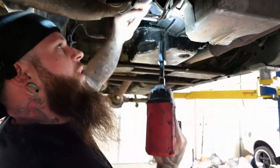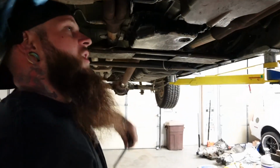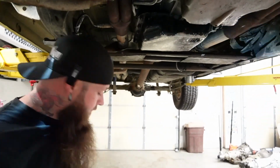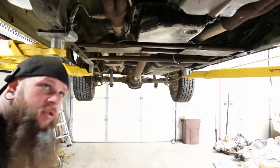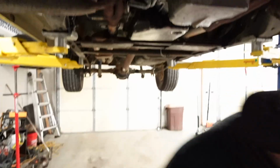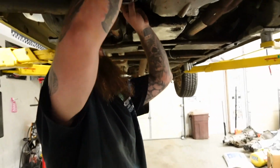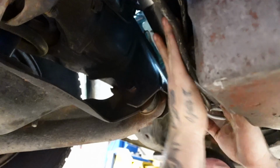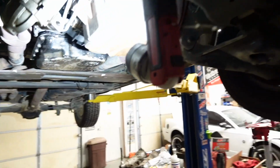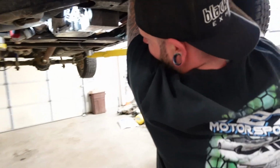Alright, so I have a feeling what happened was the battery on this impact was probably dying, and that's why the bolts didn't get run down like they were supposed to. So now we made sure we have a fresh hot battery on here to snug these things back up. But to gain us some access here, get the starter motor out of the way, and that'll allow us to get an impact in there to tighten the bolts up. So we're going to turn the motor over by hand up here on the crank until we gain access to the first bolt.